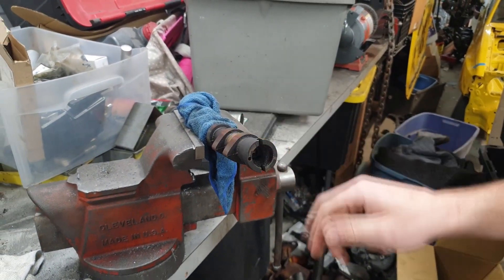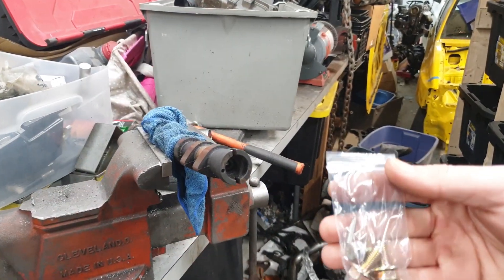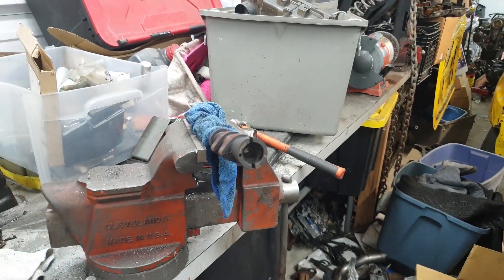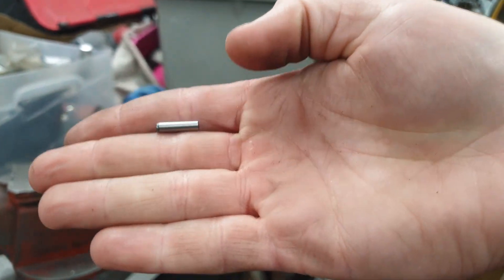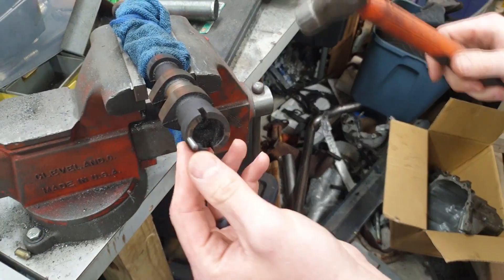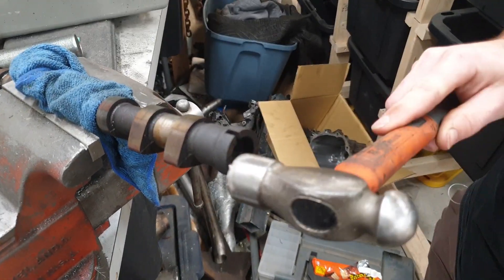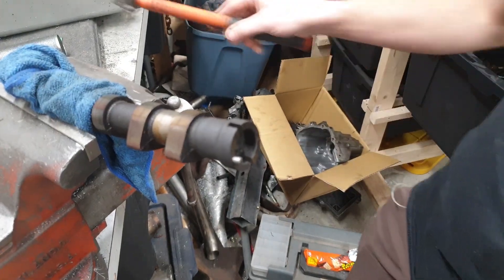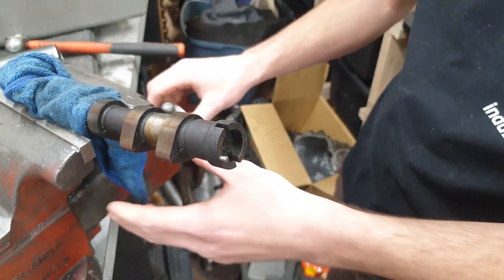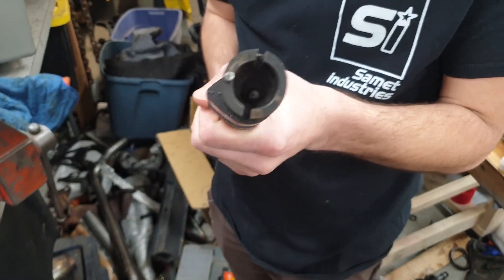Just like that. Now you'll see a very nice, properly centered, properly depth hole for our dowel pin. From our kit we have the little bag of hardware - three bolts and that little tiny four millimeter dowel pin. One end is rounded, so that's the end we stick in there, just to make it easier to hammer in. Line it up with the hole - it should not press in with just your finger. You want it nice and tight so it does not fall out; that's why we drilled a very specific size hole. Our dowel pin is in. It should be right between 4.2 to 5 millimeters sticking out. Hit it with some brake cleaner to make sure you get all the shavings off.